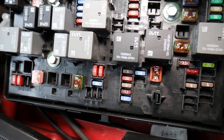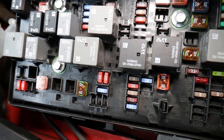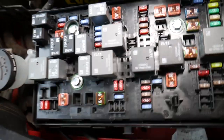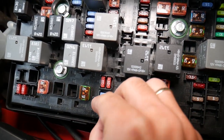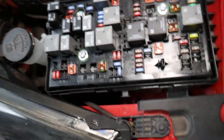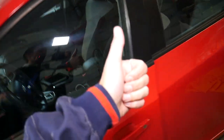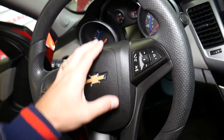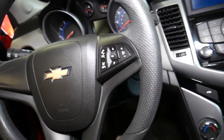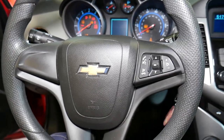We have fuse 51, so I'm going to go ahead and pull that fuse and replace it with a new one to see if that takes care of the problem. If you need to buy any fuses, the link will be in the description below. Let me put my fuse puller here so I don't lose it. Things to check: the fuse, test the horn, make sure the wiring harness is plugged in, test your switch, and if none of that is the case, it may be a bad clock spring — we have a video on how to diagnose that too. I'll go ahead and turn the ignition on and listen.